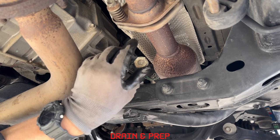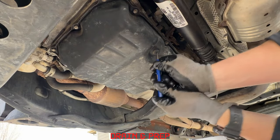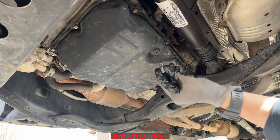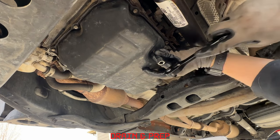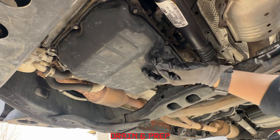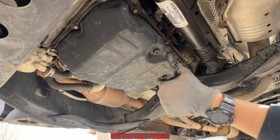We'll inspect it later but set it off to the side. The overflow, or sometimes called the check plug — let's clean it out. It's a hex. Take that 5mm hex and tap it in there. Make sure it's all the way in. We just want to make sure we can remove it. Good. Now snug it back up.